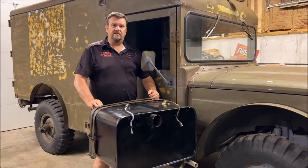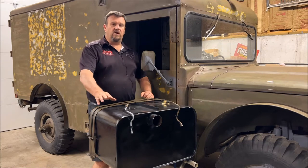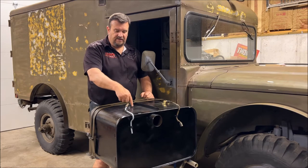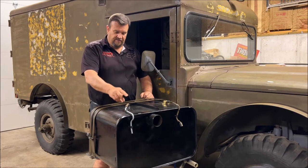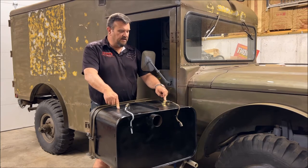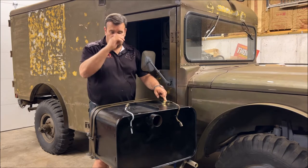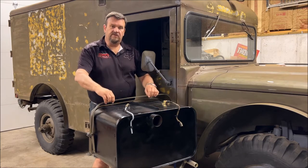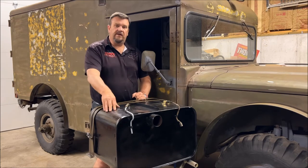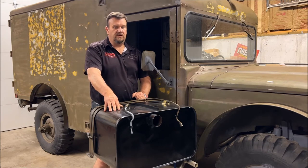Hi folks, welcome back to Green Iron TV. Today we're going to be doing some more work on the 1967 M725 ambulance — mainly doing a lot of work on the fuel tank. We had to clear out the fuel pickup line, which involved cutting the top of the tank, taking the fuel pickup line out, getting it clear, getting that welded back in and sealed. We've also put in the new fuel sending unit so we can get a good reading. We've sanded, primed, and painted the whole tank including redoing the straps. The fuel tank is now all ready to go, and after we get the truck painted we're going to get that tank back up in the truck and ready to roll.